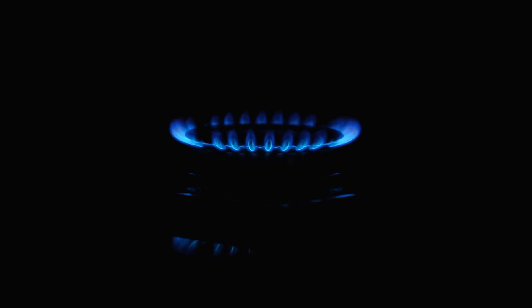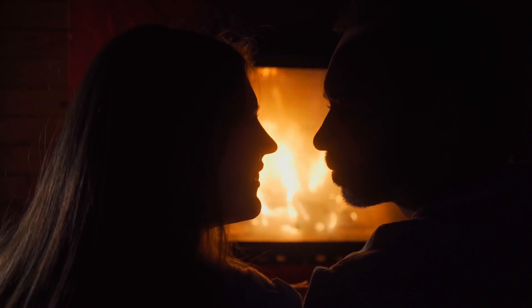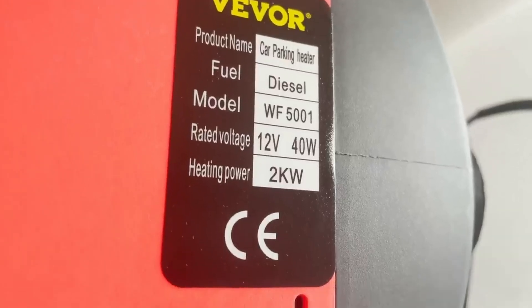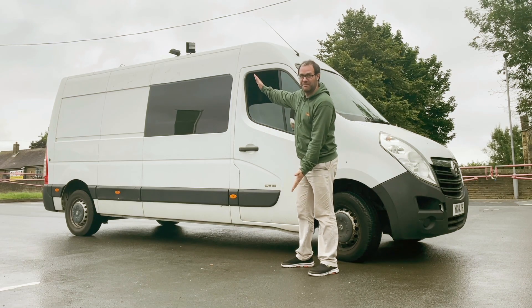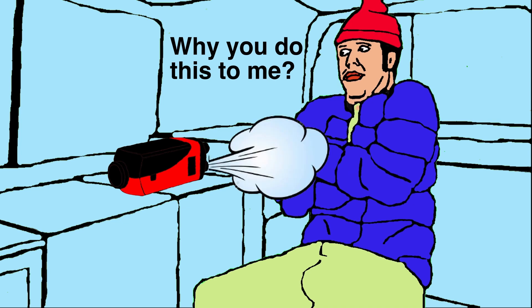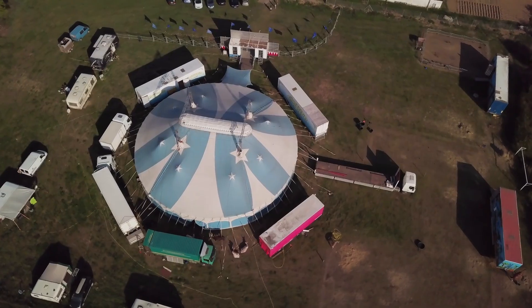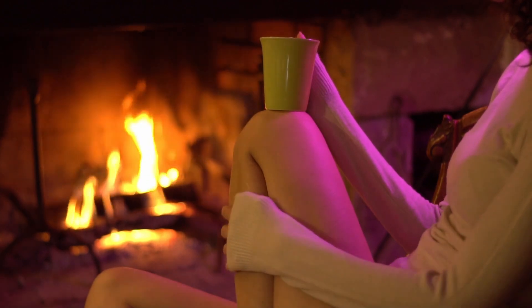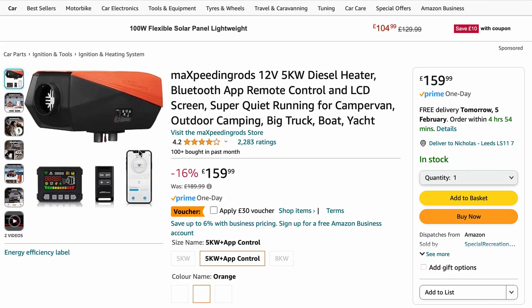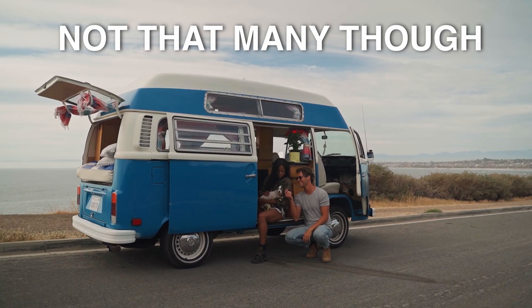Question six: two kilowatts or five kilowatts? Five kilowatt heaters are very powerful and kick out a lot of heat. If you install one in a medium wheelbase van, you will get too hot very quickly. For anything medium wheelbase or below, we suggest a two kilowatt heater. That said, a very well-insulated long wheelbase van with a five kilowatt will also heat up quickly. An uninsulated medium wheelbase van with lots of windows may find a two kilowatt struggles — it all depends on your specific circumstance and personal preference.